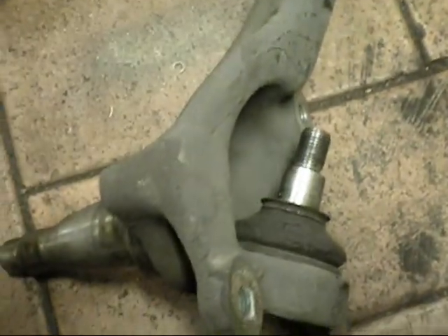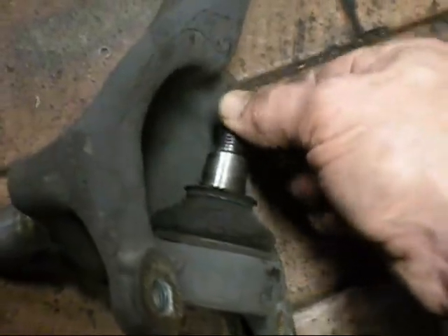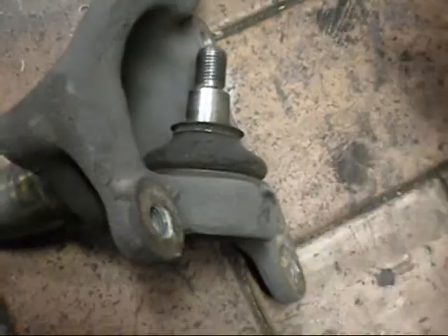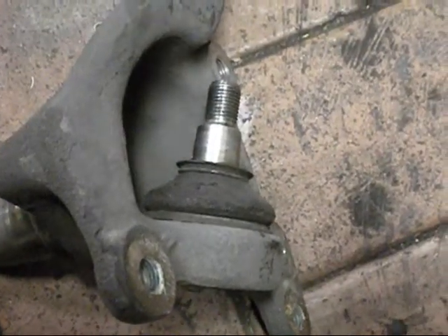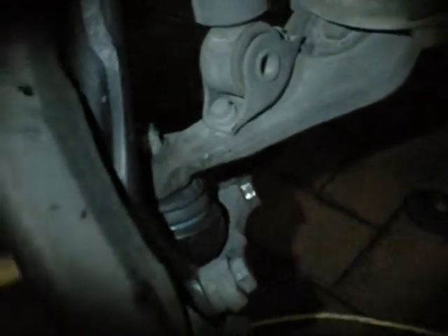I've got to change over the stub axle with a new ball joint in it, because this one's a little bit screwed — it's got up and down movement, it's very floppy. That's all done now. The top ball joints have been done at some point not too long ago. The left hand lower ball joint was still alright, but this one had obvious movement in it, so I just ordered a new stub axle changeover. They're an absolute bastard to press in on these.